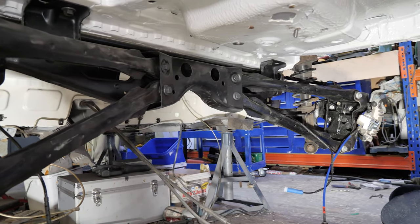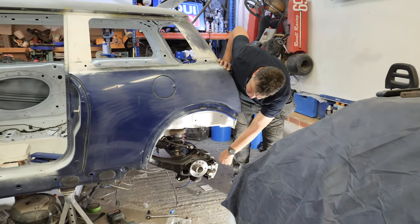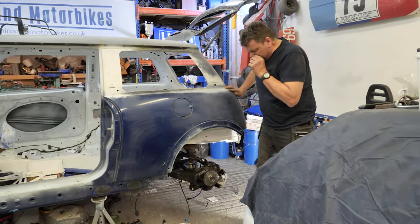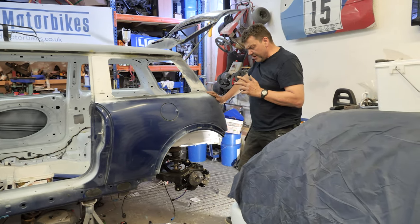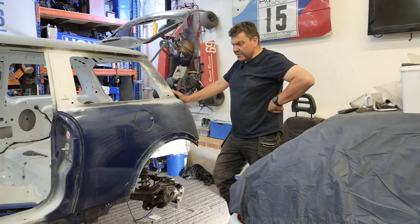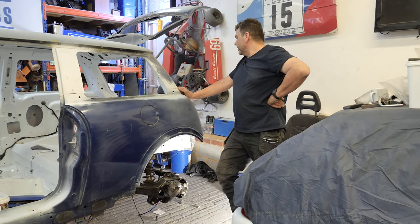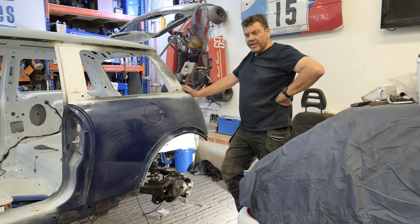change the bottom control arms to the forged ones, so they're adjustable ones, so you can adjust the camber on them because they just alter the bottom, so that pushes it out. Because I think they've got 1 degree of negative camber as standard, and with that you can obviously give them 2 or 3 or 4. I mean, the fronts would probably be -4 on the front camber. At least the back end's on, isn't it?